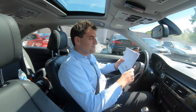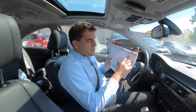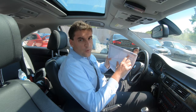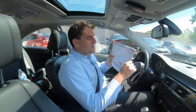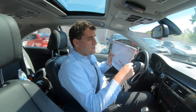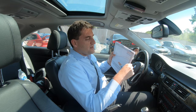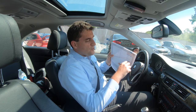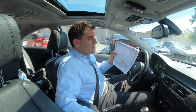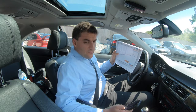We installed a three-stage intake manifold, the AA headers, and did the tune. Happy to report that has resulted in about a 30 horsepower increase at the wheels. So it went from 199.9 horsepower to 229.7 horsepower — just slightly below 30 horsepower. And at the wheels you have to apply a 17% increase for that. The torque also went from 188.2 pound-foot of torque to 203 pound-foot of torque — basically 14 pound-foot of torque more, and 30 horsepower more as a result of this tune.